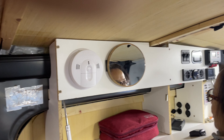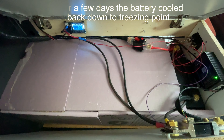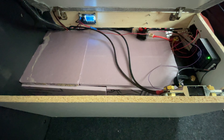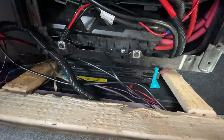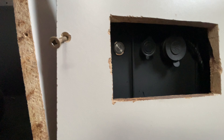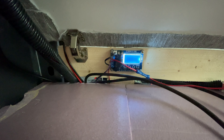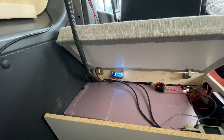With the battery box and heater I've insulated down the sides and over the top — I previously showed where I insulated underneath and put heating elements in. The far side is a challenge because it's right up against the DC-to-DC charger, and there's also a big gap where the cables are, so heat can escape there. There's not much I can do about the access side because you have to have USB ports, AC charging, and the on/off switch. It was minus seven this morning, now it's zero, the heat's turned off, and I have not been able to detect any overheating of the elements underneath.